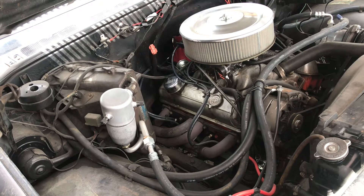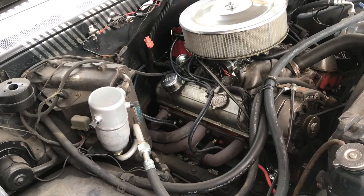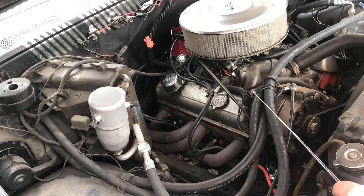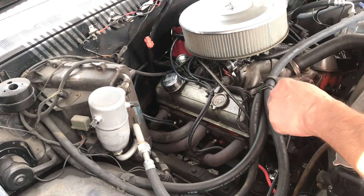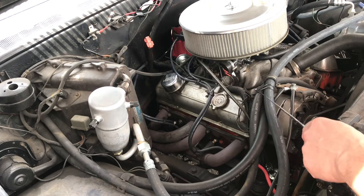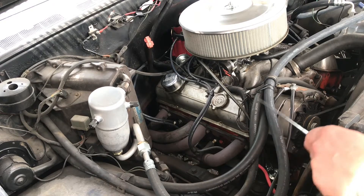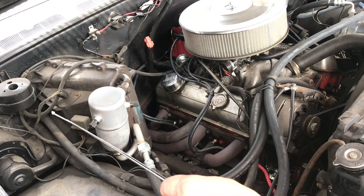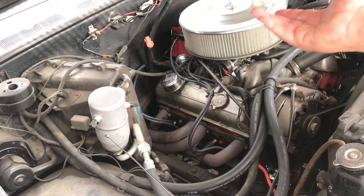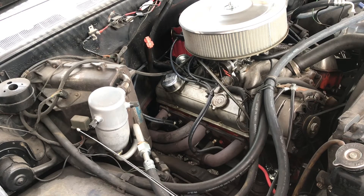What I've run into here is — I did it like everyone else. I looked at a picture on Google of how these are to be routed. The 5/8" nipple should be on the intake and the 3/4" on the water pump. The 5/8" is your feed. I thought you'd want as much feed as possible, so I have a 3/4" hose — which is wrong. So the hoses are stretched and swapped.